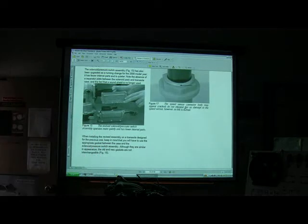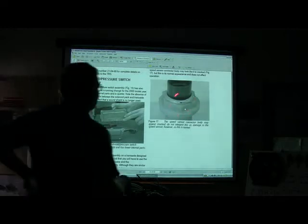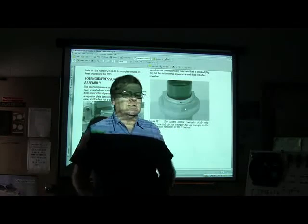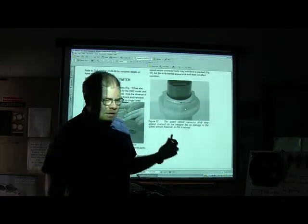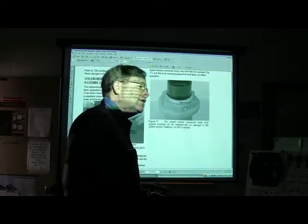All right, so now, this part right here, I'm going to show you this, too. This is important. That speed sensor, there's two of those on the front of that transaxle. You can look down there and see them. Big old speed sensors. They've also got speed sensors like that in the side of some of these pickup truck transmissions, and those little plastic sensors fail all the time. You pull a code for one of those, coolest thing in the world, you just screw that plastic thing out, screw another one back in there, plug your wires in, you're good to go.